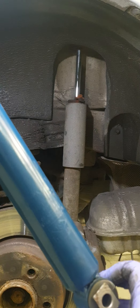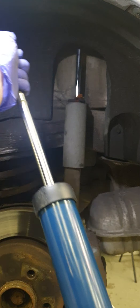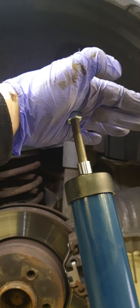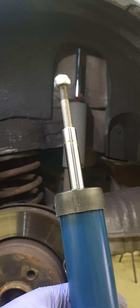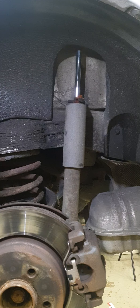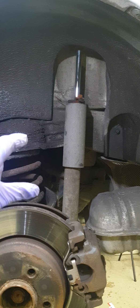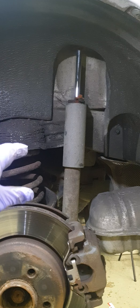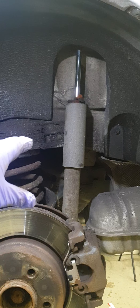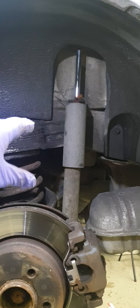You can see where it mounts on down the bottom — this one has a male fitting. Before fitting, you should prime the shock by hand, which means compressing it fully and letting it extend. You can tell it's a good shock when it comes back out by itself, as shown in a previous video. The purpose of the shock is that when you hit a bump, your spring wants to continuously oscillate or bounce. The shock absorbs that and its main function is to stop that oscillation and bring the suspension back to its normal position — it acts as a damper on uneven road surfaces.